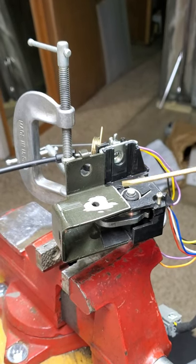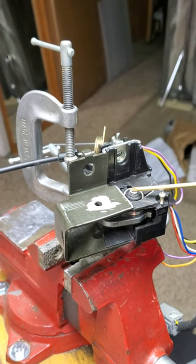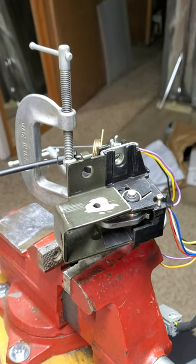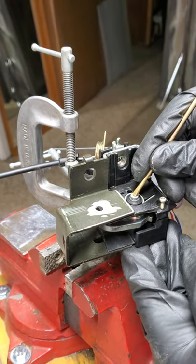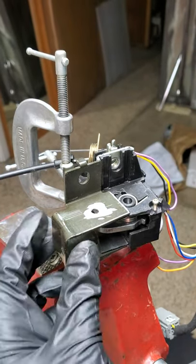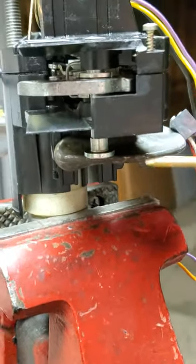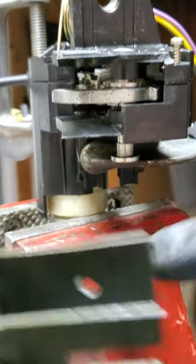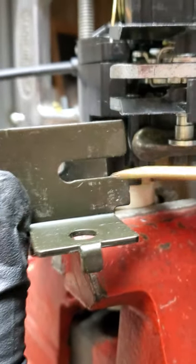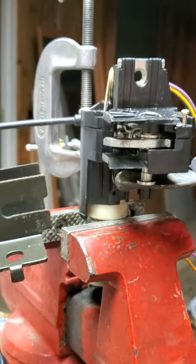To get this thing apart, I took my angle grinder and ground down this area here where this pin protrudes out. Obviously this plate should be over here. When you get that done, you can just drive with a punch this pin through about a quarter odd inch. And if you look under here, you'll see a little notch on that pin that's going to line up with this notch right here. The pin was here, now it's out, so you can slide this out. If you don't have this notch lined up with this notch, it's not going to slide out.